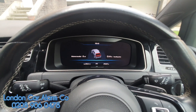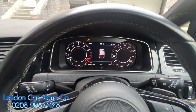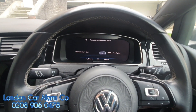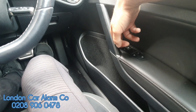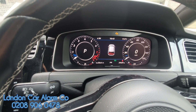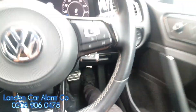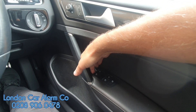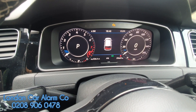I think that should be about 30 seconds now — let's try and start it. There you go, it's 30 seconds. So what I'm going to do now, finally, is show you how to actually change the code. First of all, pass your authorization: ignition on, insert your push sequence — one, two, three, four — wait for your double flash. There you go. Then foot to the floor on the accelerator, insert the same code again. When it begins to flash, you're now at learn mode.